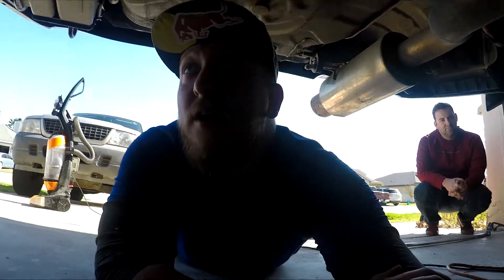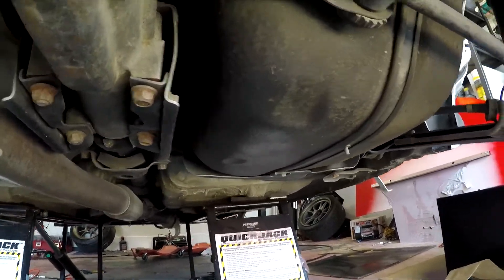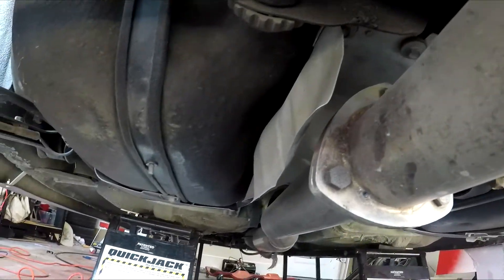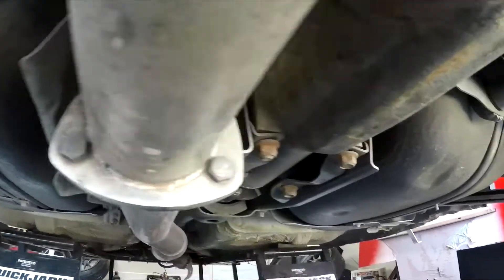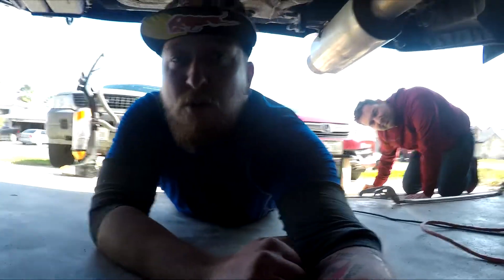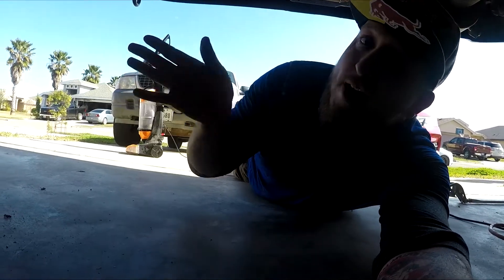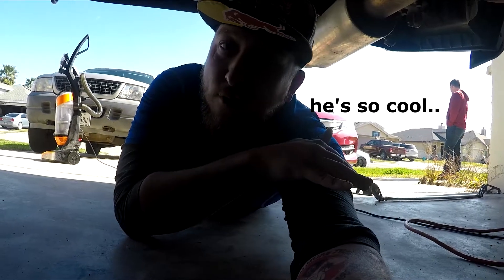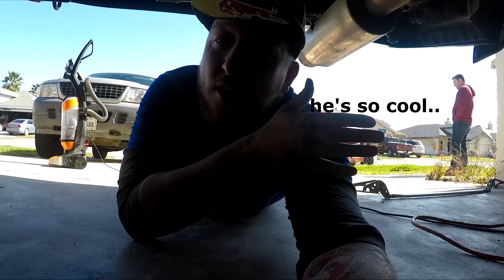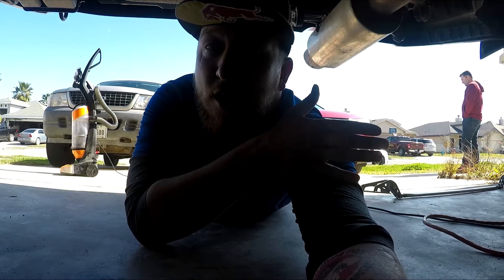So this is the right side of the tank and this is the pickup. It goes up and over the exhaust and it's on this side. There's a high point in the middle of the tank, but the pickup's on the right. So under high-G corners, like right corners, when you're going right, all of your gravity is banging left — all the fuel will jump over to the left side over the saddle. And eventually if you're running not enough gas, it will starve out and your motor will start to spit and sputter. It's definitely not good for it.